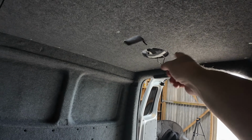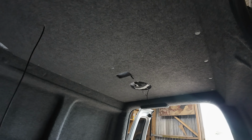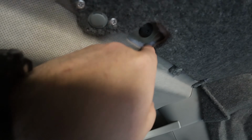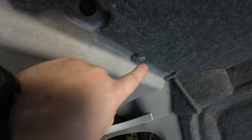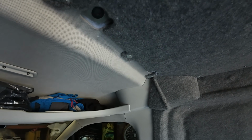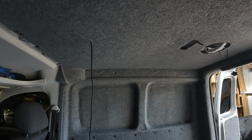Just got the fan light, interior light, and the dimmer set light to fit now. Looking good, that is. One little tip that I would give though, for anyone that's doing this and putting your roof lining up after you've insulated, is this. Make sure that you haven't got any insulation under that part there. Because I had insulation from the roof, it was going under there and all under there, because I've insulated all of this as well, and we couldn't get this up to get the clips in, and it was a right pain. Real challenge.